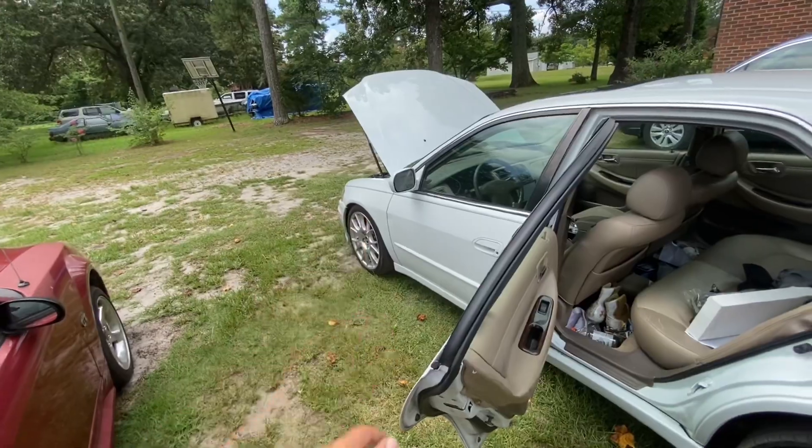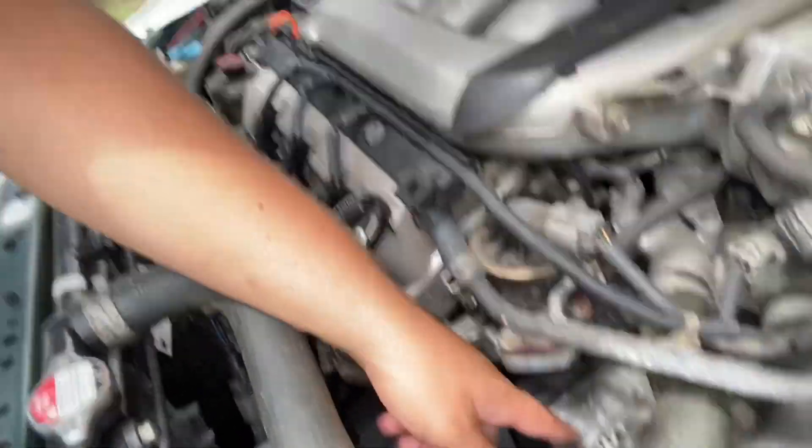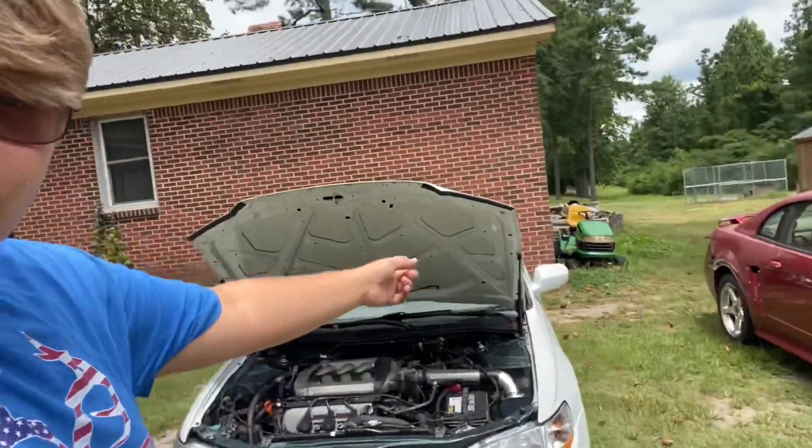I'm not worried about the stance right now. Now that I'm talking about all the simple bad things, I'm going to go ahead and get into the biggest bad topic of this car right now. This right here is the four-speed transmission for these cars and I'm pretty sure mine's starting to let go. I've had the issue of it going from reverse to drive where it used to stall the car out and cut it off completely. Now it's getting to the point when you take off down the road it's starting to go. It sounds like the bad tires but it's actually the transmission — I found that out when you can hear it in between gears and shifting. So that's a problem I'm facing right now and I don't know what to do.